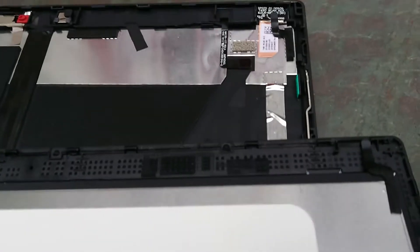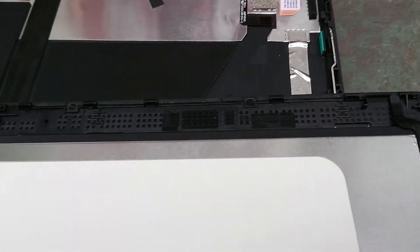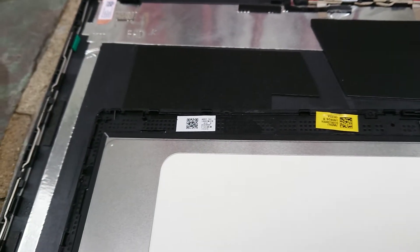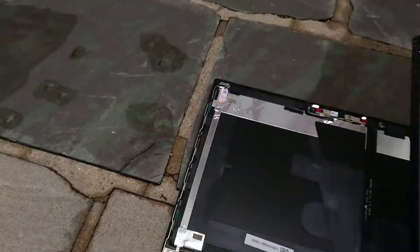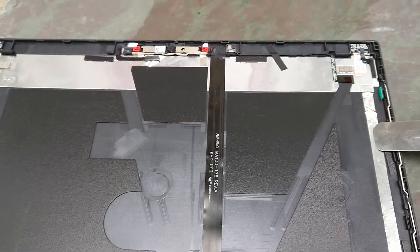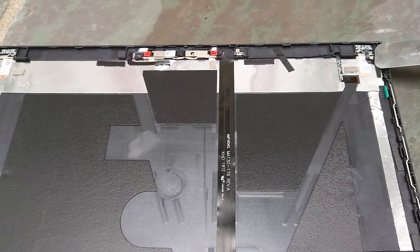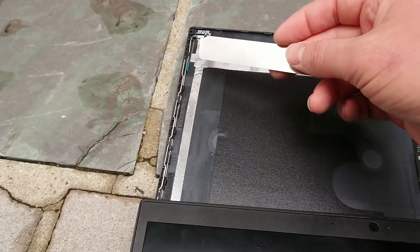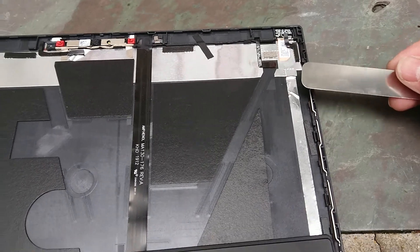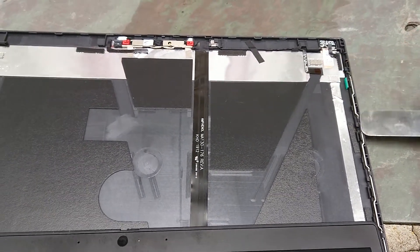Take a better look at these clips and see where they are positioned — pretty much just go along the very top. The only real tricky part seems to be these silver parts here and some of the parts on the edges — they're stuck on with a sticky adhesive. So as you pull it back, you want to get under there and undo the adhesive so the screen comes back without ripping up the silver part along here.